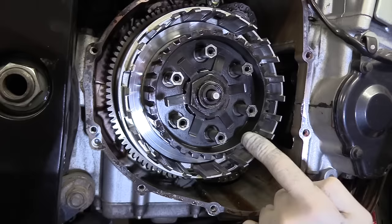So don't stick gaskets to the engine. You can just use, like this, regular grease on the paper gasket on this side. It will still seal, believe me, I've been doing it for years, it works very well. Just don't put it on bone dry. And that nice seal, if you ever need to get it off in the future, it will come off intact on the casing. There we go.